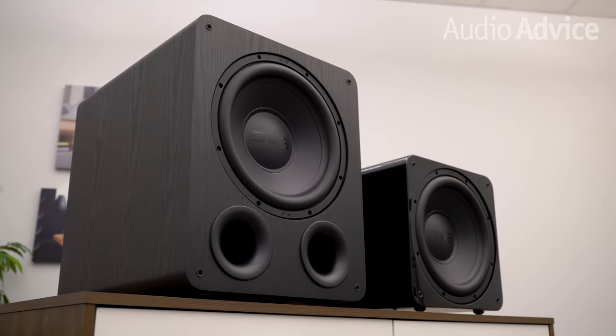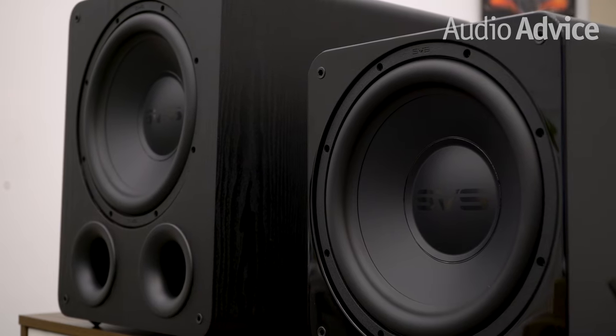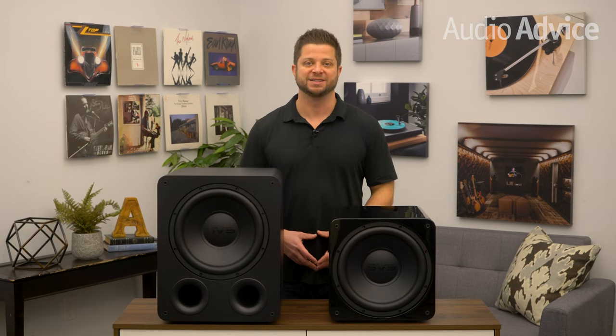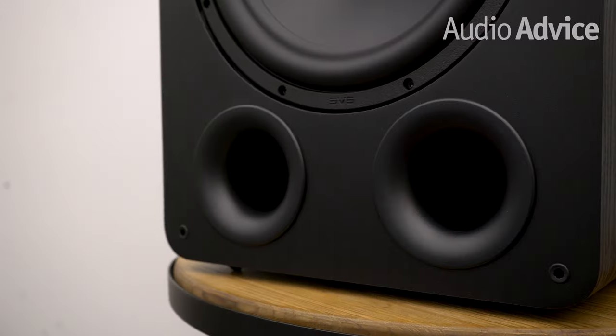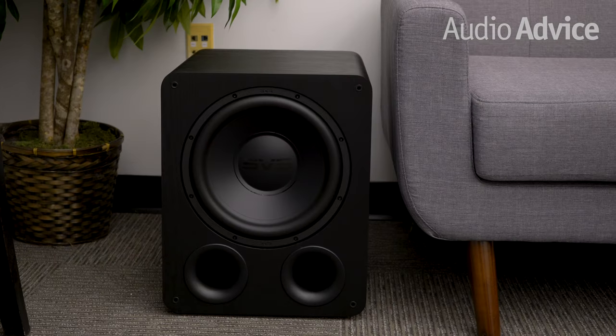Let's quickly cover some differences between sealed and ported subwoofers. A sealed subwoofer is essentially a subwoofer inside of a sealed box, and this type of configuration is usually smaller. If you have great small speakers, you are more likely to find a sub that can blend with your main speakers if it's sealed. As you get into a larger room — say, 2,500 cubic feet or larger — the demand for great bass performance matters a lot more. One small sealed subwoofer in a large room is just not going to be enough. A ported design is generally larger since there needs to be extra room for the woofer and the ports. The ports allow air to escape, and this allows you to get a bigger sound out of just one box since there are two different mechanisms moving the air around. We have a great article that covers all of this in more detail, and we'll provide the link in the description.